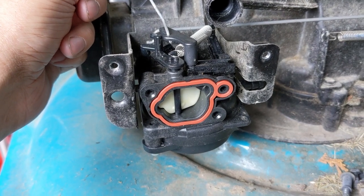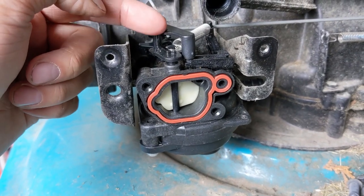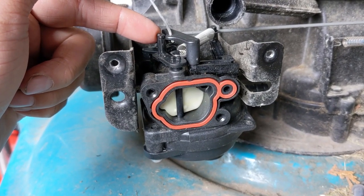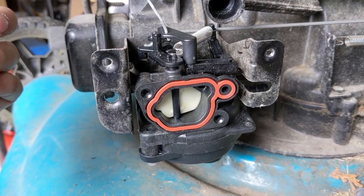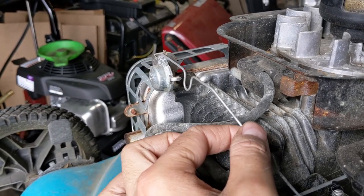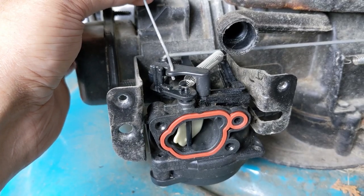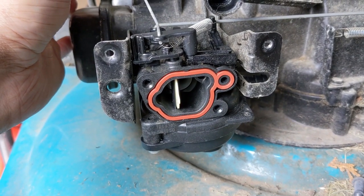So just a quick little refresh on how these engines work. When your engine's cold, the choke lever right here is always reset to the closed or choke-on position so that when your engine's cold you can start it up and it gets maximum fuel. There is the bimetallic strip right up there, and once your engine warms up it pushes on that rod. Once that arm starts to rotate forward, you'll see that it engages the choke lever, opening it up.